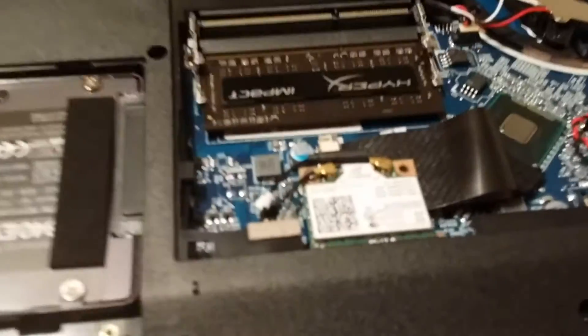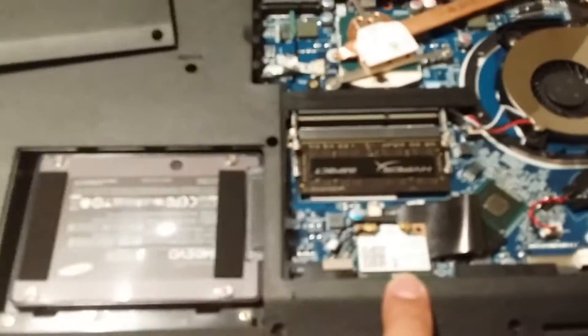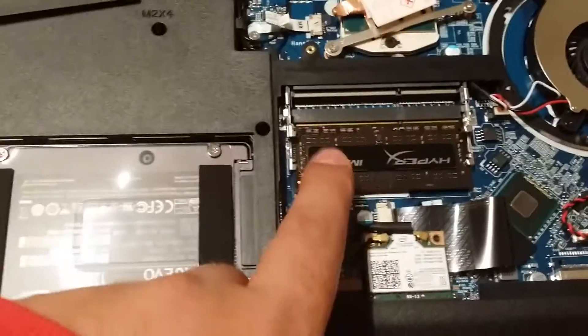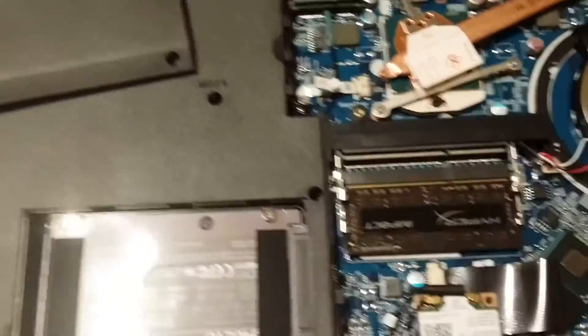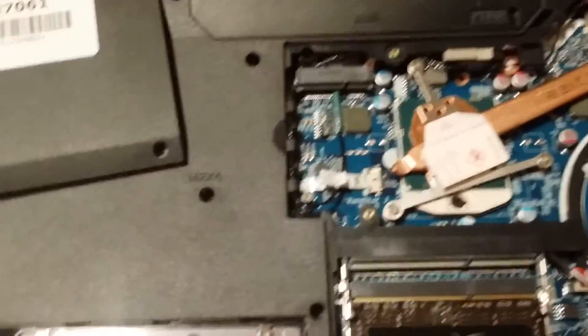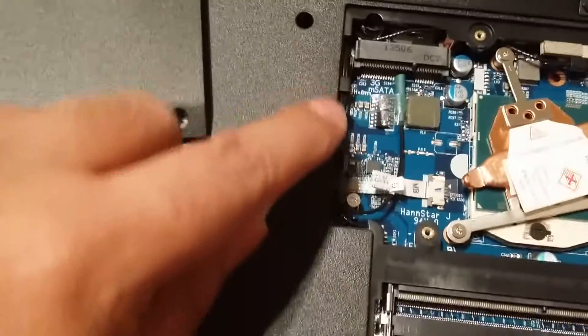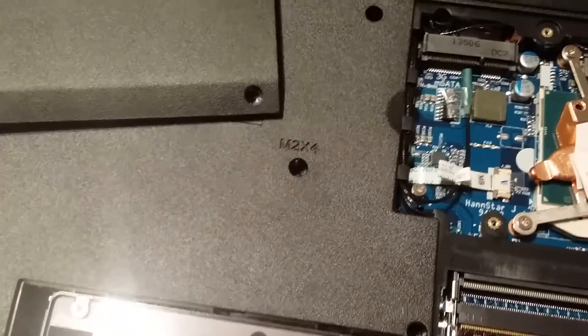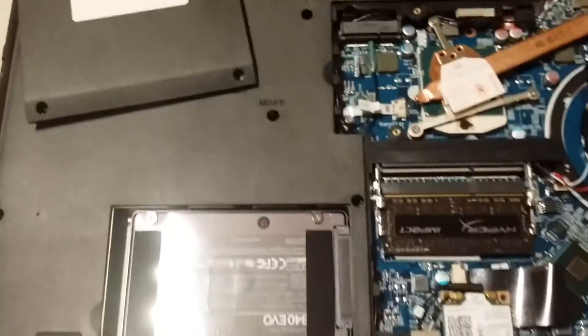Let's have a quick look at what's in here. Here's your Intel AC7260 Wireless 2x2 MIMO - that is a beast by the way. Single HyperX Impact 4GB RAM - I'm going to stick a second one in there, hopefully pick one up in the Black Friday sales coming up. Interestingly, there is an mSATA slot here. I'm assuming you could definitely stick an mSATA drive in there - there's enough space for a nice 256GB or something. But still I don't see where that second 2.5-inch hard drive would sit.